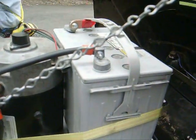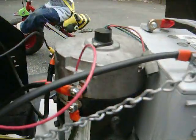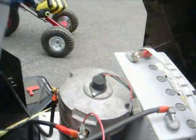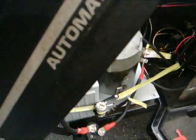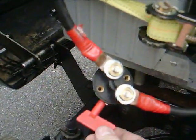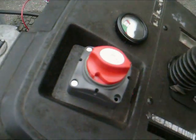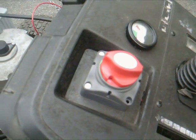I've got one separate battery up here, which is a 12-volt deep cycle battery, which will excite the field before the armature settings come on. I have a switch on the other side which basically turns that on. Right here I've got this battery switch key that I put in and turn on. And then I also have this switch up here which turns on the main pack, because you're not supposed to turn on the armature until the field is excited.